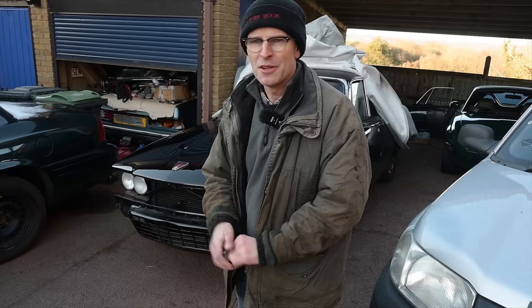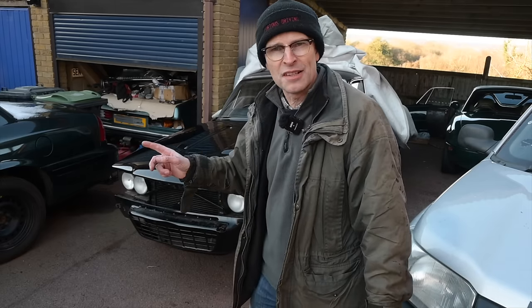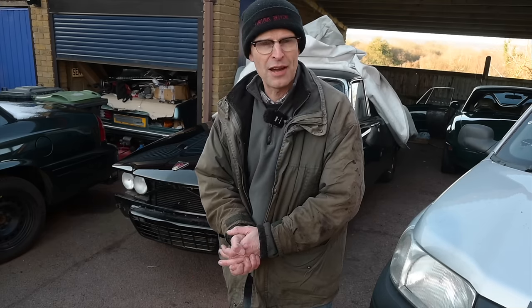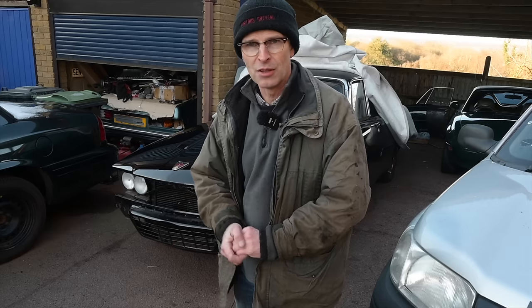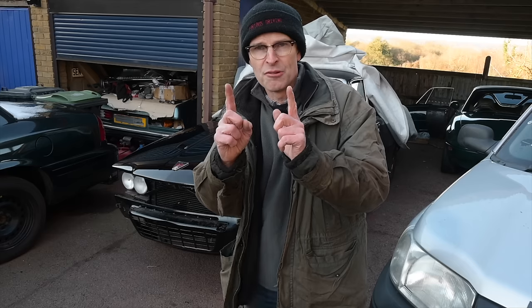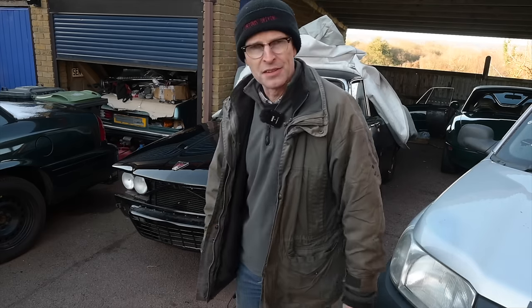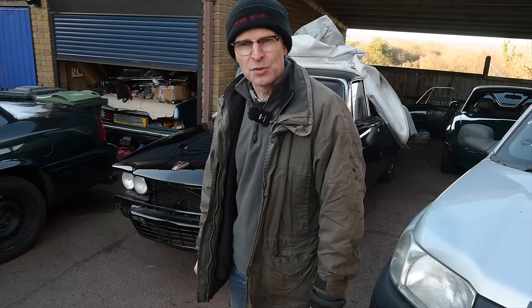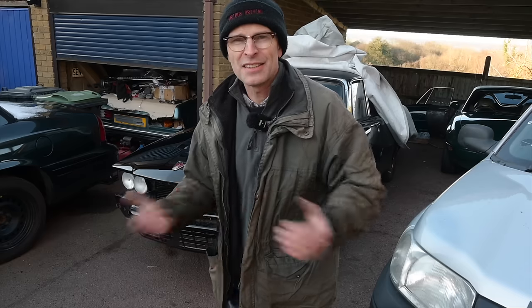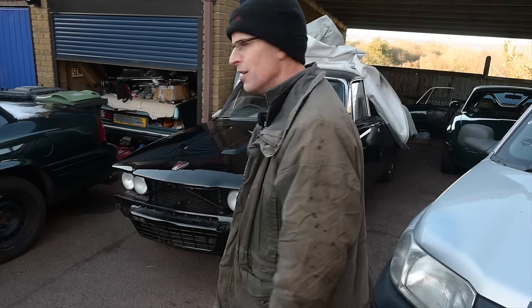So this is a fair bit of time of just chasing I don't know what fault. I'm at a slight loss as to what's actually failed. Possibly the electronic ignition module inside the distributor is broken. Possibly there's an earth I haven't noticed has fallen off. But nothing, to my knowledge, has changed beyond the position of the coil from being close to the engine to being that much further away from the engine, which shouldn't make any difference at all, but apparently it does, because now the car doesn't start. And this has become a big source of frustration over the last few days. I'm a bit stuck, which is not fun. So yes, again, this car is just doing its absolute damnedest to beat me for no good reason. I want you to run, car, but it doesn't want to run.